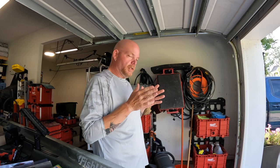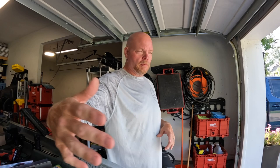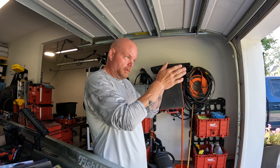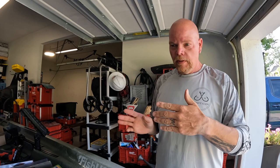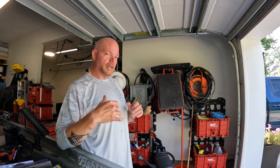As far as the colors: your red goes on your port side, which is the left side when you're facing forward from the bow. Green goes on the starboard side, which is the right side when you're facing forward. So red goes on the left side when facing from stern to bow, and green goes on the right side. Facing the boat from the front: green on the left, red on the right. In your seat facing forward: red on the left, green on the right.